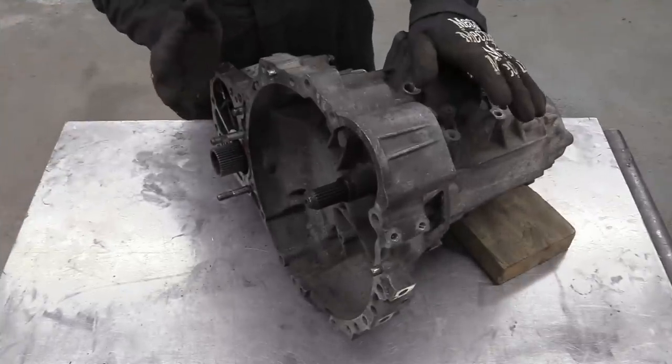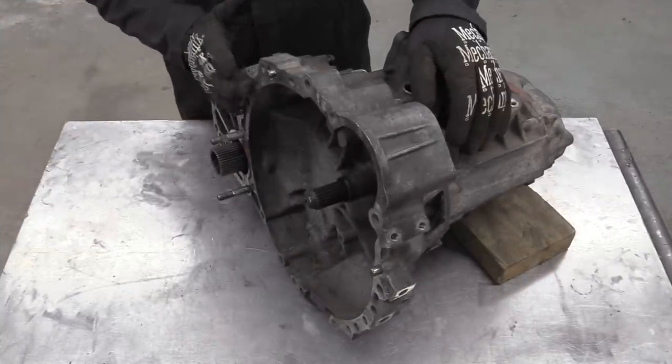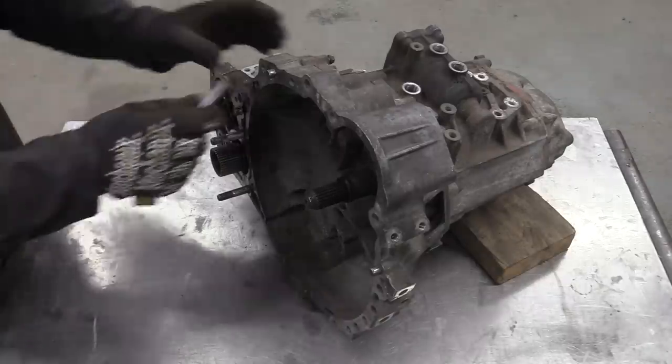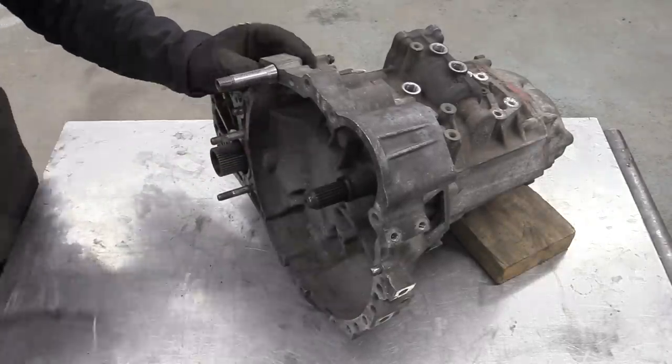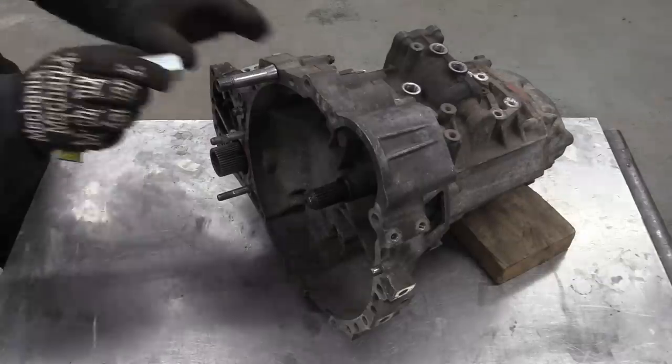Not really worried about any of the others, but at least one of these two dowels needs to go in the engine first, so I need to get them out of the gearbox while there's still some weight in it. A dowel extractor wasn't something we had in our armoury, so we whipped one up using bits from around the workshop, including an old collet and a couple of connector nuts.